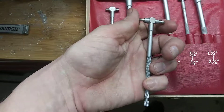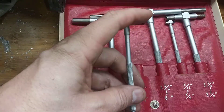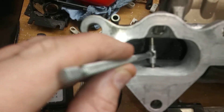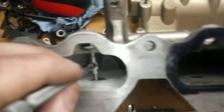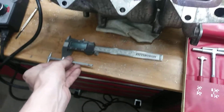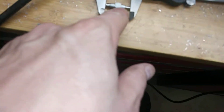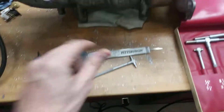The way these work is you stick them in and these fingers will move in and out. When you get it in place, you turn the knob at the bottom and that locks them in place. Then you use your dial caliper to measure that distance. So I go in to my one inch mark and try to make sure it's straight up and down vertical in the port. Then I turn that to lock it — that locks those fingers in place. Then to measure it, quite simple — you just measure the distance with the caliper, and that gets you your number. That's how I measured that one inch in, and I measured it on runner number two as well so I can have a before and after.